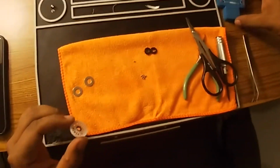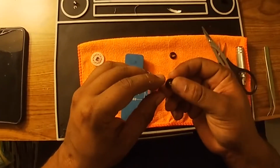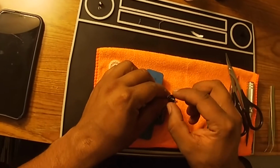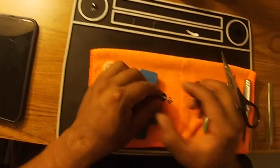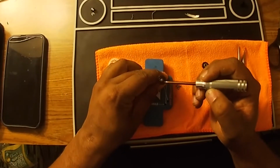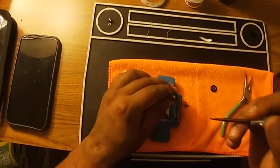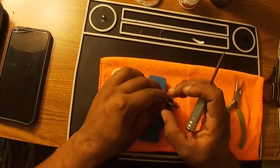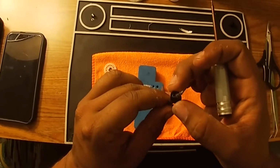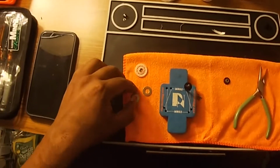So all right, cool. We're gonna go ahead and bring the shaft back, the axle, and get the bottom side of it, which does not have a bearing, and throw it in this puppy. Okay, it's only one way it goes with the GL. With the PN, you have a slot that goes this way as well, right? So not only do you have the slots that way, but you have them this way. Now what you want to do with that is make sure that you pick the side that's going to be the most free moving when you go up and down like this on the PN one. It's going to have less friction on that rear diff, which is very, very important.